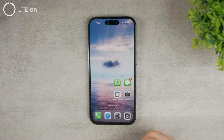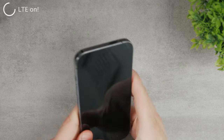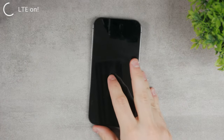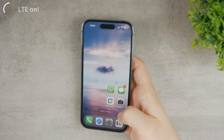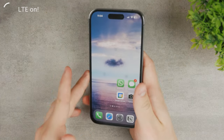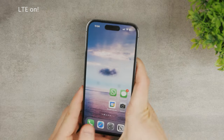Another thing to try, especially if you have an older iPhone or a physical SIM card: if you've been using your physical SIM for a while, go to your carrier and have them replace it. SIM cards wear out over time and get worse the more you use them. Make sure to keep the same phone number and ask for a new physical SIM — it should be a free service. Or switch to eSIM altogether, because your iPhone will definitely support eSIM at this point.